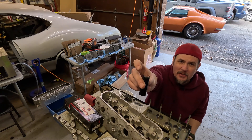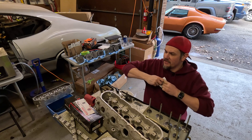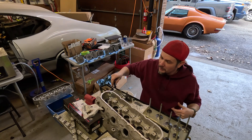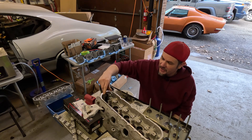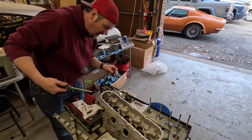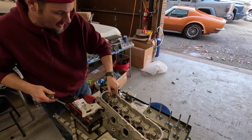I don't know where I picked this thing up, but you can see it's just this metal piece with an eyelet, and it allows you to use a screwdriver basically to install your valve seals. And I know there's probably ways of doing it without buying a tool, but this just helps to make sure that everything goes on straight. Grab a screwdriver and just like so — our valve seal is installed.